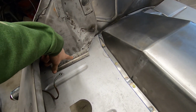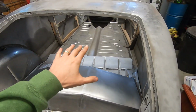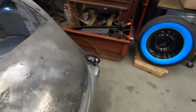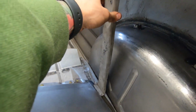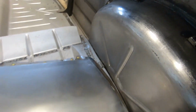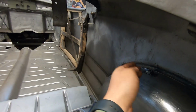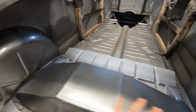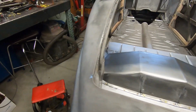So I gotta either bolt or spot weld these guys to the floor. And the braces that I made for here, good thing I didn't put those in yet. Not the ones I made, they were already made, I just modified them. So let's see, this is a passenger one. So this went, these two holes in there, underneath, down to the floor, but now, since this piece has to be removable, I'm not going to do that. I'm going to cut it a lot shorter, and do an angle from the top here and spot weld it to the top of the wheel wells on both sides. So that'll work out good, give it a nice area so it's not in the way. It's kind of tucked over.